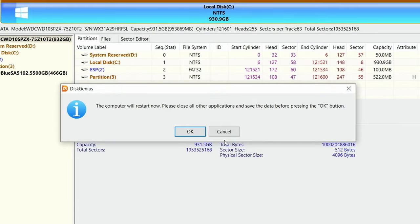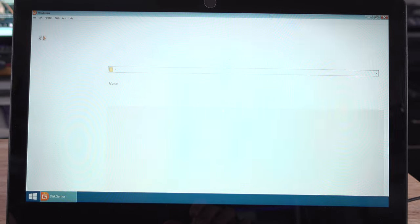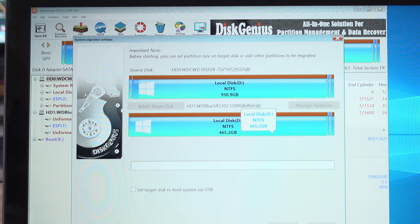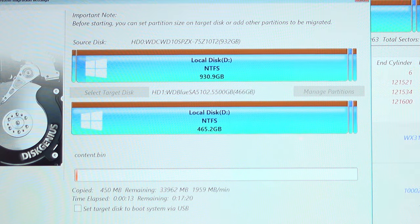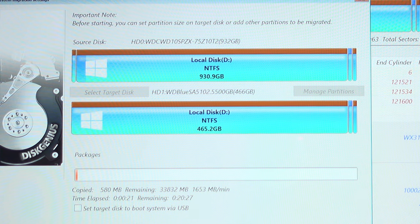The hot migration takes a snapshot of your running OS and copies it to the new drive. We'll select Reboot to WinPE — it creates the Windows PE environment and restarts. Close other applications so you don't lose your work. Now we're in WinPE mode, which looks very similar to Windows 10. The estimated remaining time shows 17 minutes — not too bad for a clean install.